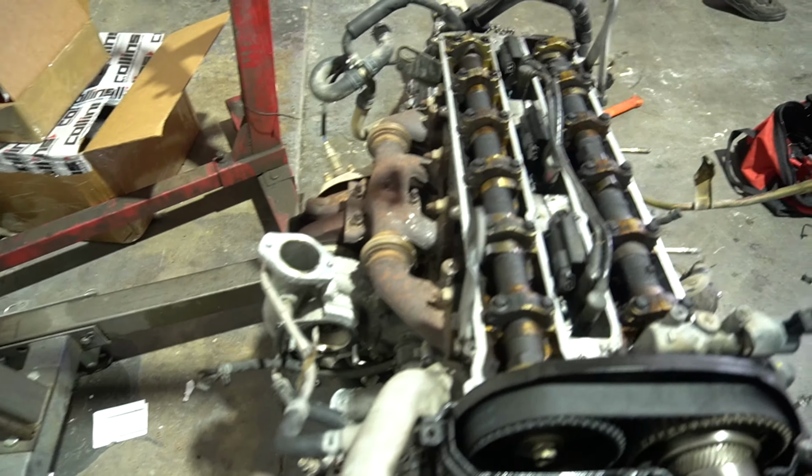The other thing too is, who was the tuner that you guys spoke to? Jason from Unrivaled Tuning, right? Yeah, Rival Autoworks. Jason from Rival Autoworks. So let me rewind back to the beginning of this vlog. The biggest thing we were scared about is, since we are running stock ECU, you can't really upgrade a lot of the stock stuff because we aren't gonna have time to tune it. So we spoke to Jason from Rival, and he basically said, as long as we don't go over 14 pounds of boost, right? Yep. As long as you don't go over 14 pounds of boost on a 1J, your stock ECU should be able to read the air to fuel ratio mixes, right? So that is basically what we're doing.